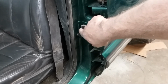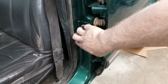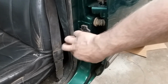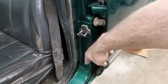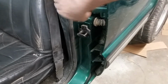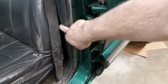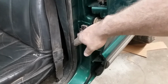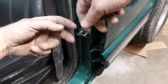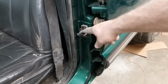There's a similarly shaped piece inside of this B-pillar that's got the nuts affixed to it or made into it that allows a little bit of adjustment. There's nothing that holds it there, so when you take both bolts out, it falls all the way to the bottom of the B-pillar, and there's some styrofoam stuff down in there to catch it. But you need to take this piece of trim off and get your fingers up inside of here. There's a big hole right in this area, and you can take that bracket off from the back side with a pair of long needle nose pliers.